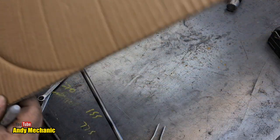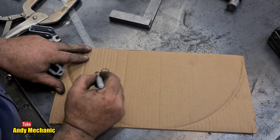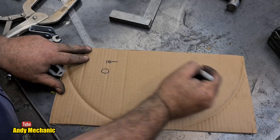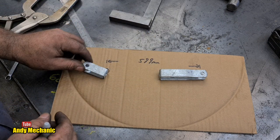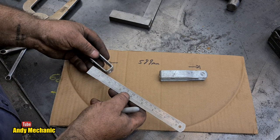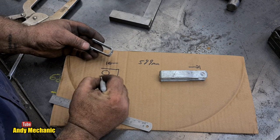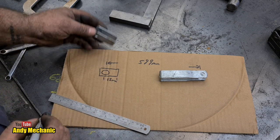Hokey-dokey, it is time for some more drawings. So, we've got the hole on the balance bar, right? We've got the hole on the handbrake, and we know that between the center lines of those two holes is 599 millimeters. Now we have this and we have this to accommodate. So now I know it's in that orientation, but it doesn't matter for this calculation. So we need to measure what they are. So if we have the bar come through there, let's say by 15 mil, so we have the clevis around there, and we go from the center line to there, 15. Apologies for the large pen.